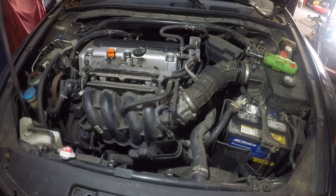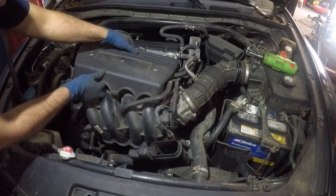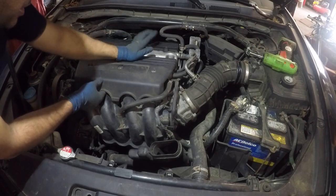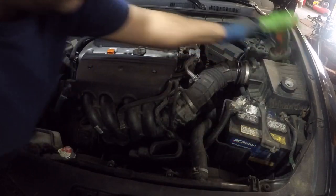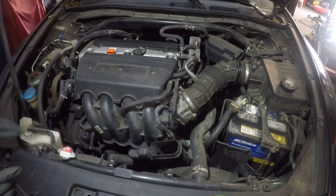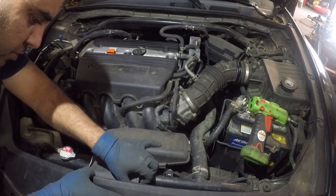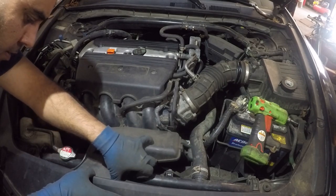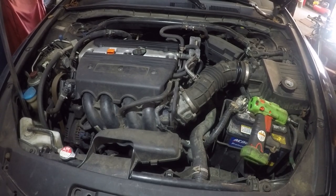There we have it — magic! If you have a 2003 to 2012 Honda Accord four cylinder, that's how you replace the starter motor. Don't forget to put the cover back on — the little grommet goes into that piece, align it and give it a tap. Put the number 10 bolt here and there. Put the top air duct cover back with its two clips. Thanks — subscribe, share, and like all my videos. See you on the next one!